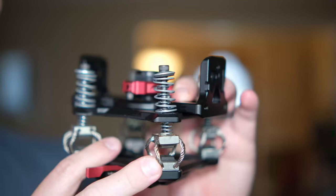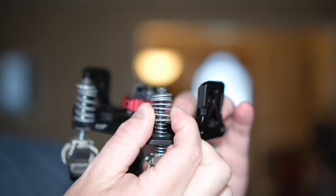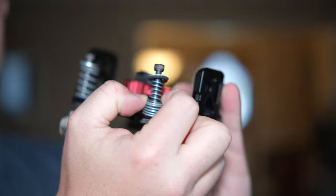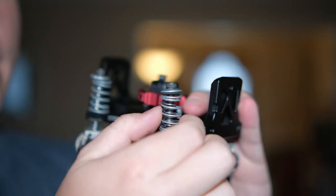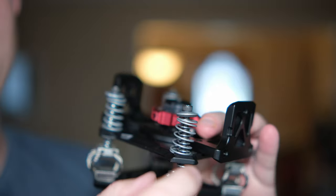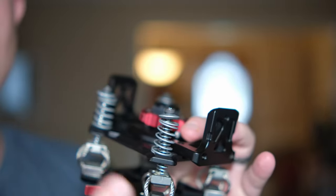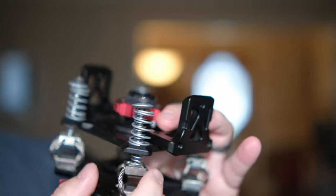I have a two-stage spring system up here. I have a large and strong outer spring. And if you guys can see in there, there's a thinner, lighter inner spring. And so that basically made it to where I could really dial it in, because one super stiff spring was just too much. I couldn't find the perfect single spring. So I layered a couple of them to get the benefits of both.